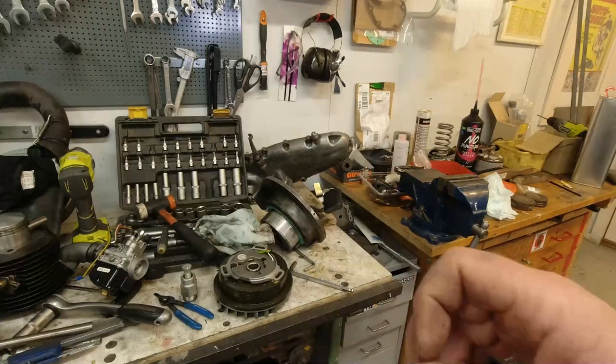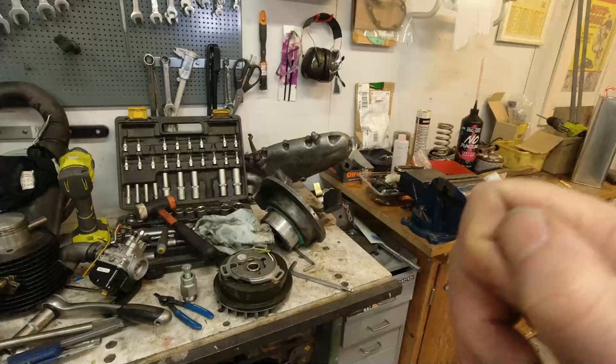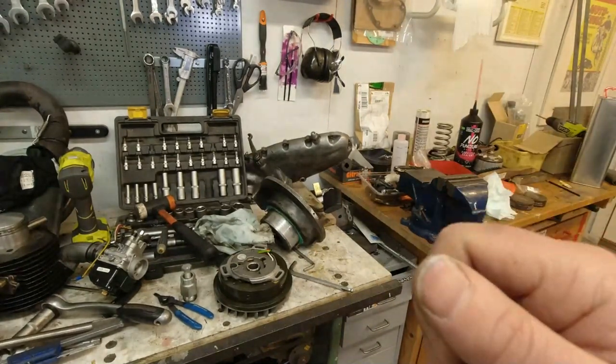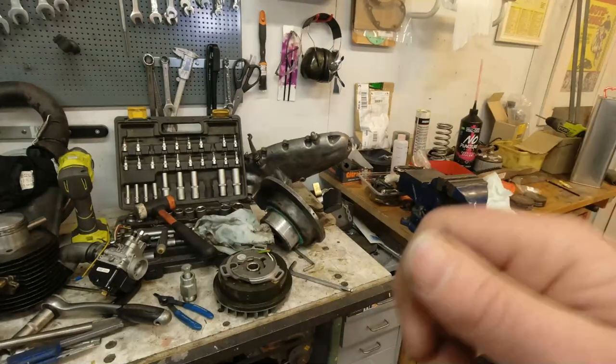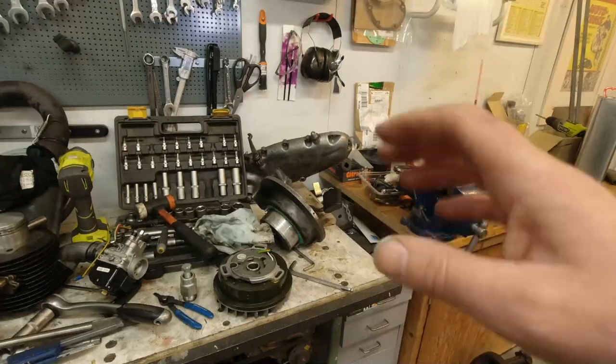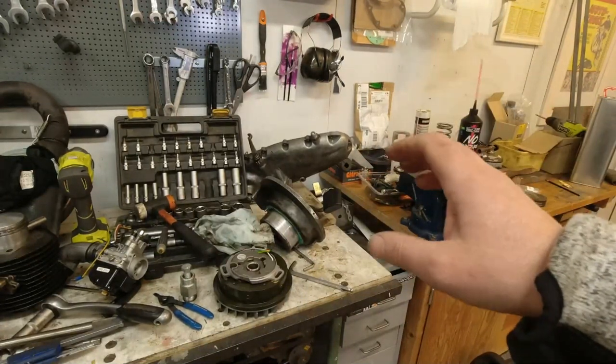The first ones that I had, they were really, really tight on the bearings. The new ones, they are not so. As long as you put the bearings in the freezer and you heat the housing up really well, then you can just drop them in without using any brute force whatsoever. So that'll sort out his issues with false air.